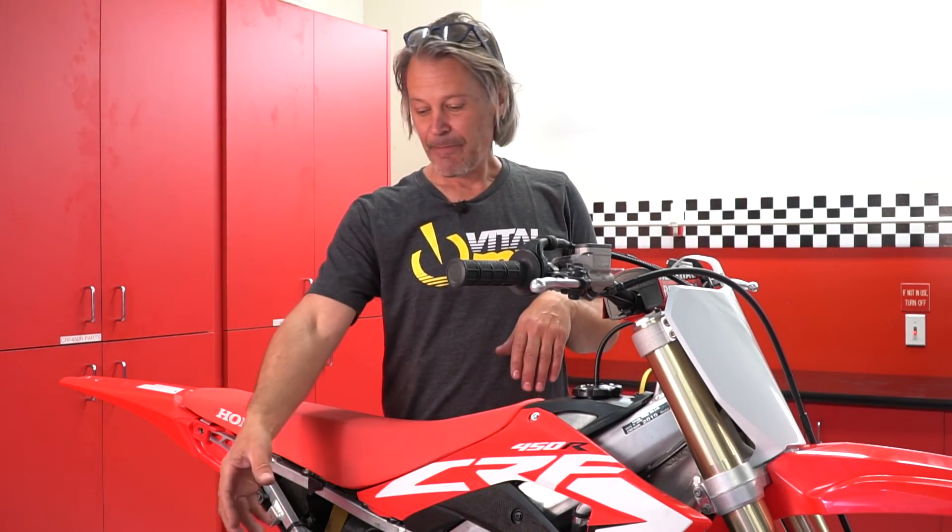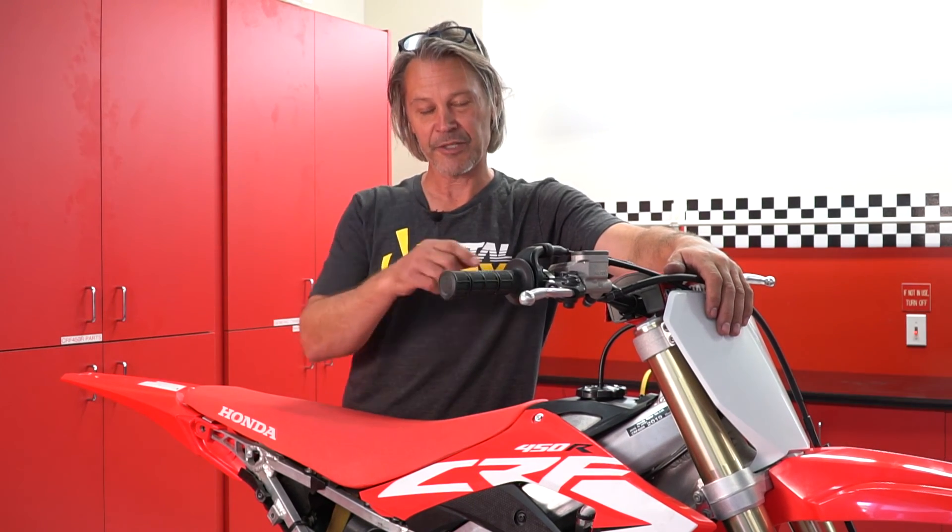The one important thing to remember: there's really no order to loosening everything, but when you're tightening, tighten the mounts that pinch to the frame first, then tighten your engine hangers to the engine itself, then the bottom engine mount, then the swing arm pivot — and you'll find that your bike works much much better. If you like the videos you're seeing and would like to see more, let us know. You can subscribe by hitting the subscribe button and you'll see these videos more often. Thanks a lot from VitalMX.